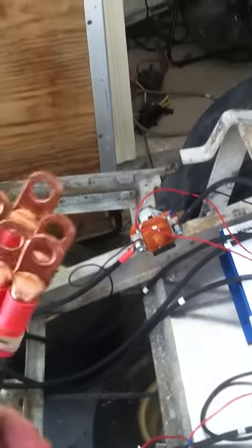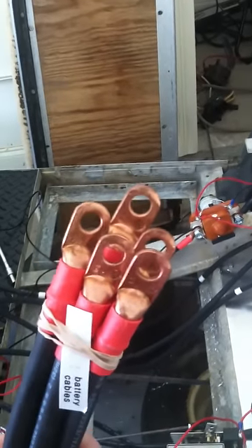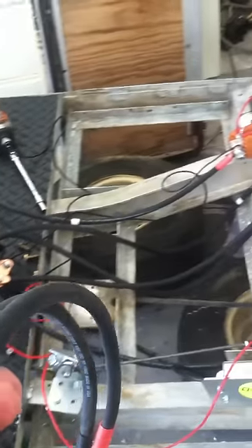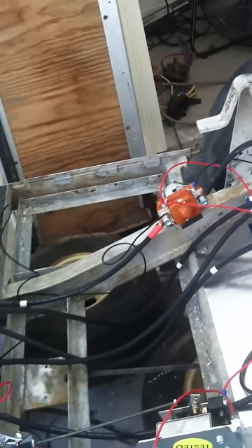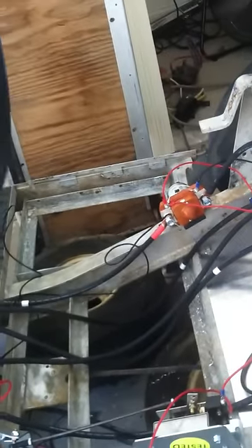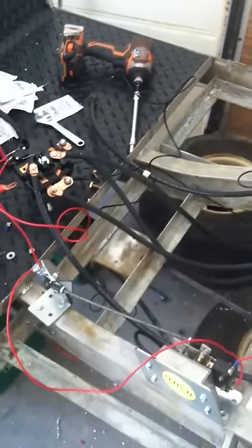One last question — you gave me battery cables and I'm assuming these are the regular cables for running six 8-volt batteries for 48 volts. Then you gave me cables labeled 10 and 11. I never found a number nine, and I'm assuming that's because there'd be confusion between nine and six, so you skipped it. I'm assuming cables 10 and 11, since they're the same length, are the ones made to go to the back battery well for my two extra batteries.